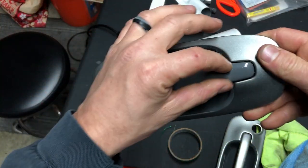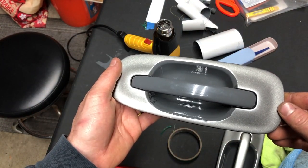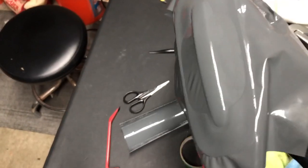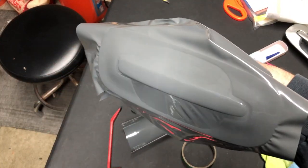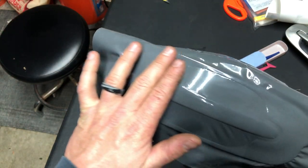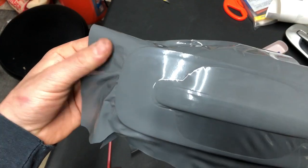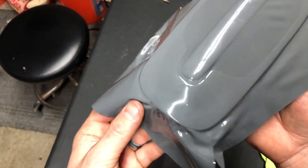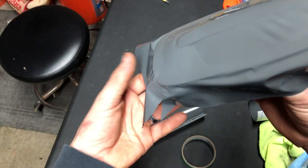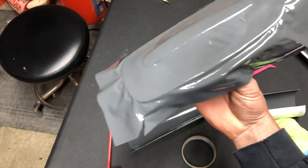This part of the door handle was really no big deal and it's looking pretty good. I took a moment and grabbed a huge piece of vinyl and went over the whole door handle, keeping the vinyl I'd previously wrapped already on there. I was able to lay the vinyl all the way along the top of the piece — didn't film it thinking I probably wouldn't do it. Laying vinyl with one hand is super hard — you spread your fingers out, heat it up a little bit, and then evenly put pressure down. So far so good, it's looking pretty promising.